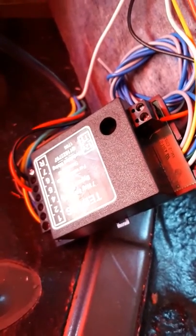Hi guys. I've finally got my electric sorted out on my tow bar after a lot of messing around. What I've found out is you've got to fit the bypass relay, otherwise you'll end up with all sorts of errors on your car electrics.